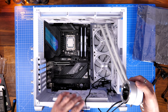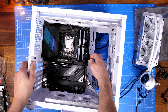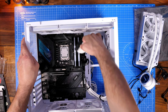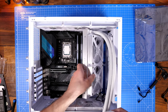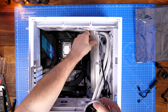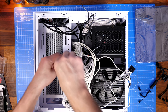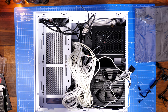There's enough space at the back of this case to mount the radiator there. One reason to plan ahead is cabling — I'm plugging in USB-C, USB cables, and the main motherboard power cable, which creates a lot of cables on the right side. Depending on your motherboard, cables may stick out too far to mount the radiator this way. I had trouble fitting the radiator and fans with those cables positioned there, but I managed it in the end. Don't tighten all screws fully at first, in case you need to reposition.